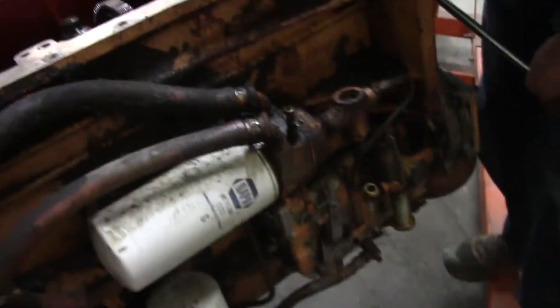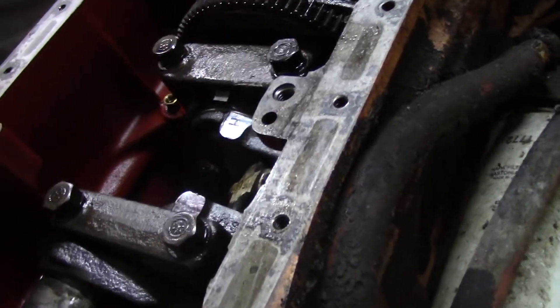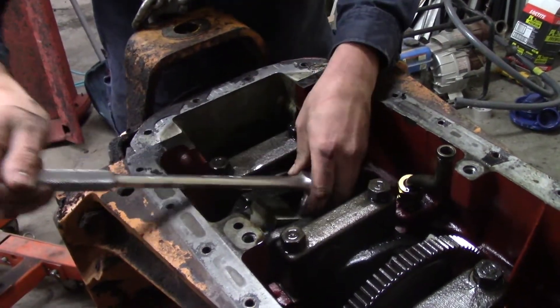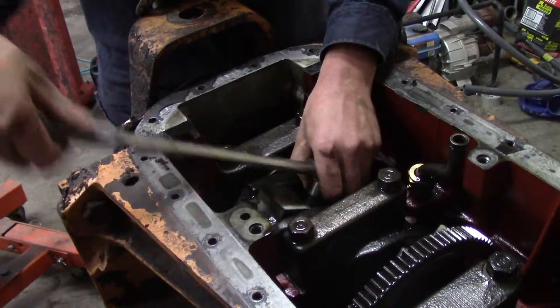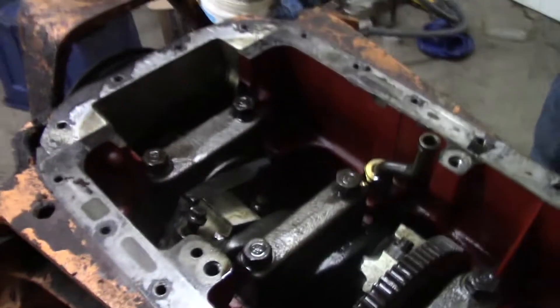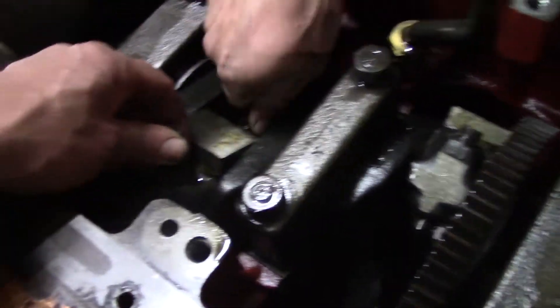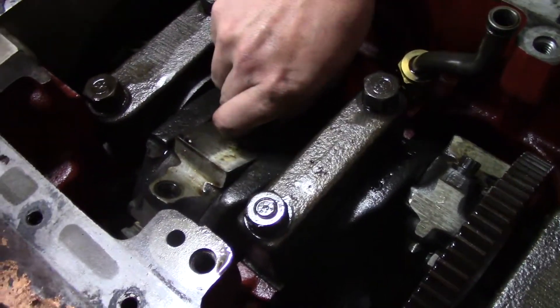Is the handle in this? Yeah, okay, I'm holding the handle a little bit. You can't get on there, huh? Lookie there. Alright, that one moved pretty easy - closer to the oil supply. These two guys didn't do it. You think that last one would have been the one to do it? Maybe. See, that moves easy - that makes me a little leery about the condition of the rods, how tight it was with no side play.